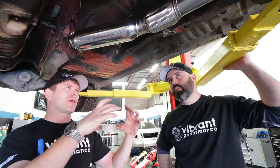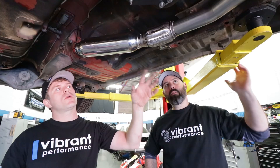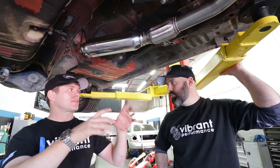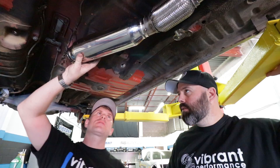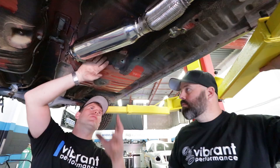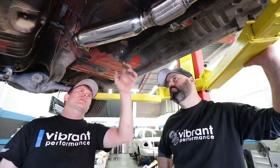By the way, we're using two and a half inch OD tubing — 304 stainless. All the components added in between the tubing and the connections are all referenced ID, so it makes it easy to slip things in and make small adjustments while you're fabricating. Since we didn't have a lot of ground clearance and needed to keep things tight to the chassis, I went with the 1793 resonator — a four inch round body, 18 inches long with a two and a half inch inlet and outlet.